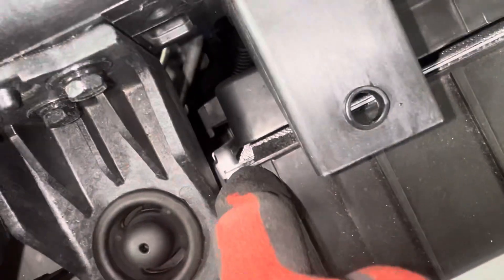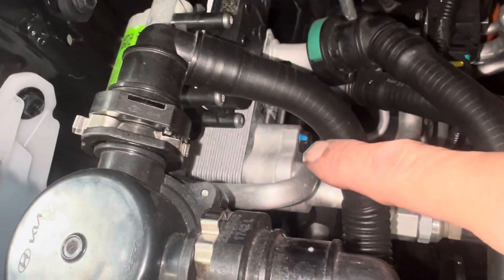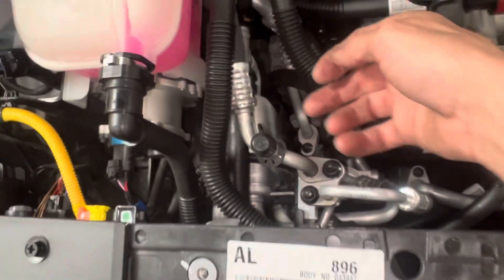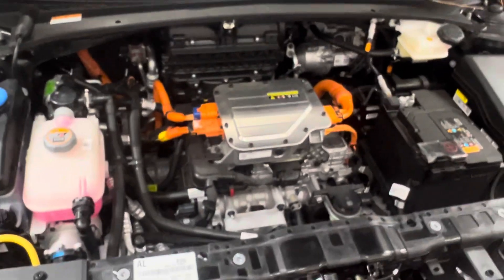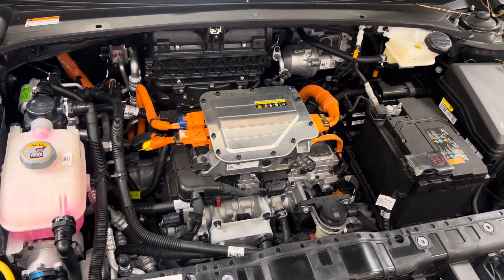The one behind it has plastic headers — that is nothing more than a glycol loop going to the plate heat exchanger. And it looks like there's a second glycol loop, so you have two glycol loops on two different circuits that get cooled down going to two different plate heat exchangers. You have refrigerant going through these plate heat exchangers in one direction and glycol coolant going in the other. With a compressor burnout, the refrigerant oil is all black — and it's inside these plate heat exchangers. See you guys later — enjoy when this comes to a shop near you.